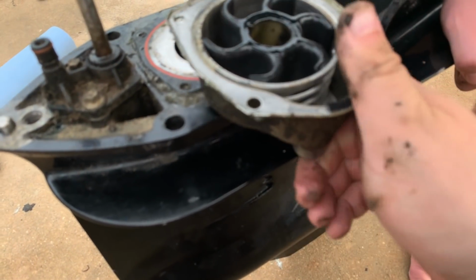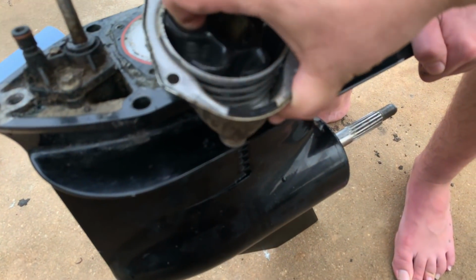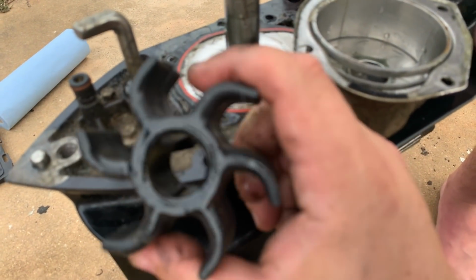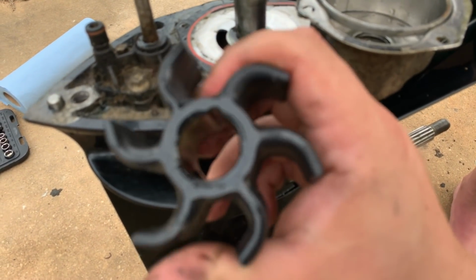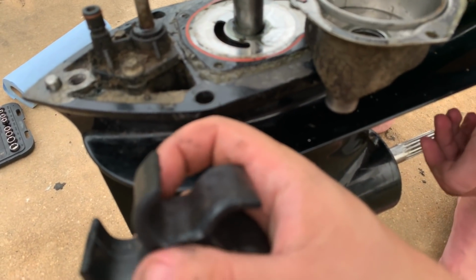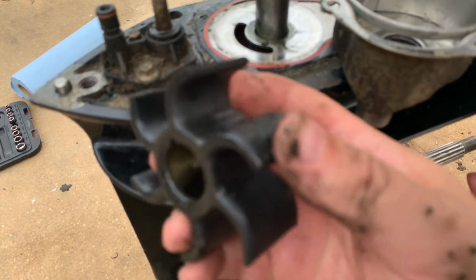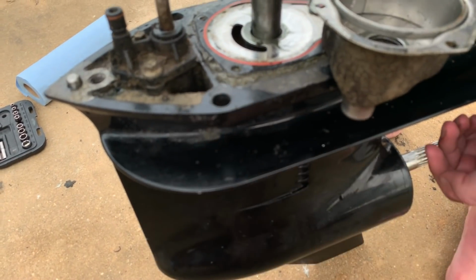It's the only reason. But still, they age and they set, and what happens is the rubber parts right here, you see how they retain the shape they are? They're not as flexible as when they're brand new. Eventually they get brittle and these blades break off, and that's how you end up getting stuck with an overheated engine somewhere in a really bad spot. So that's why you generally want to change them every other season at the very least.